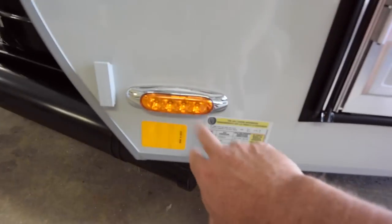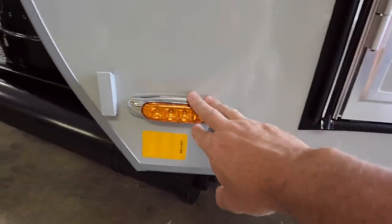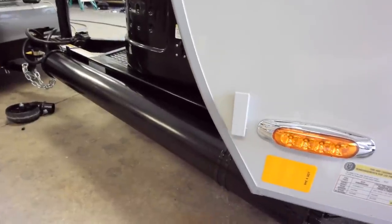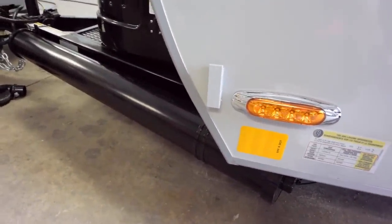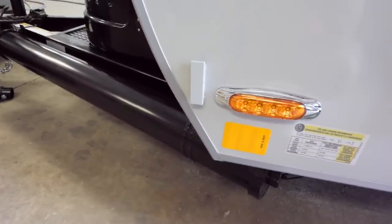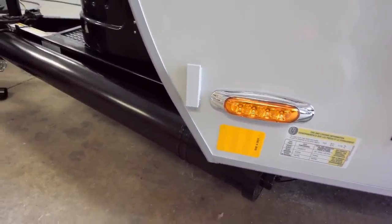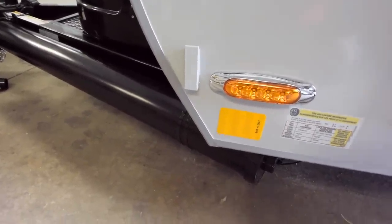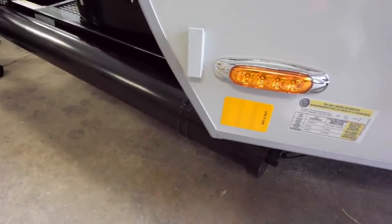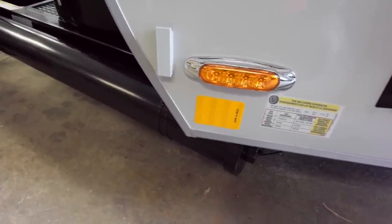All your lights are LED inside and out, which is a real nice thing. With some cars, they don't like that when you connect to the car wiring. On my Ford Escape, it will flicker and give bulb error messages because it wants some resistance, thinking you have regular incandescent bulbs. The workaround I discovered is you just turn the headlights on, and somehow that magically fixes everything and everything works normally.